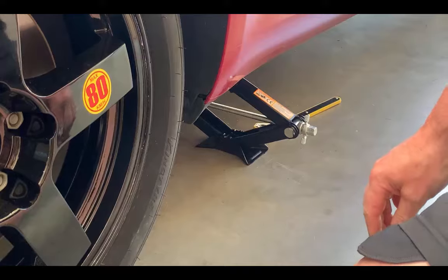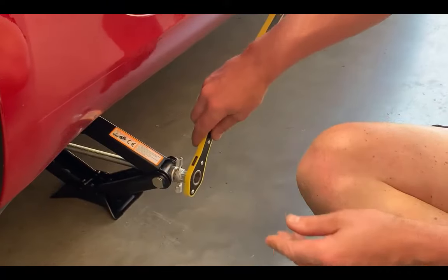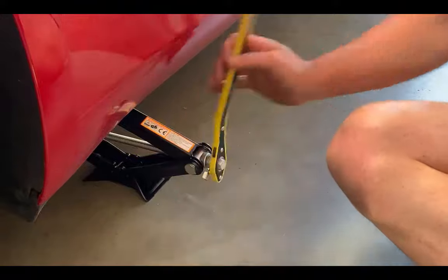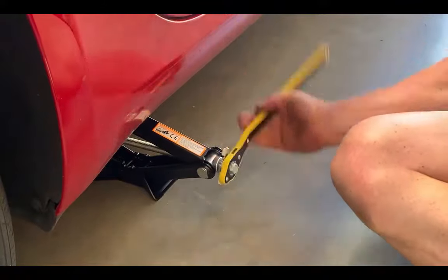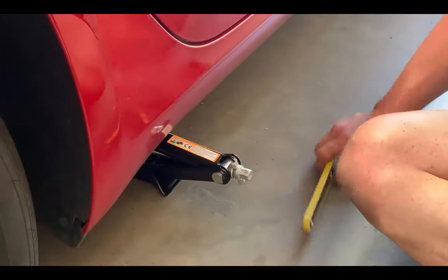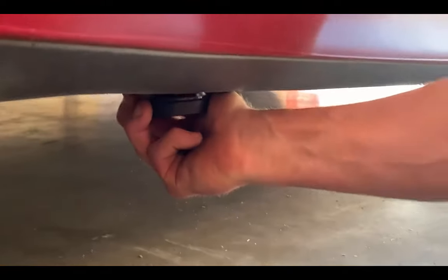You don't have to turn the ratchet back the other way - just click the button and the ratchet will work in the reverse direction to lower the jack. Do exactly the reverse of what you do when winding up. Get the jack completely out of the way. There's something we must not forget to do - which happens a lot - and that is leaving the puck in. Take it out before you forget: put your hand under, give the puck a bit of a twist and a turn, it will come off. Place it out of the way.